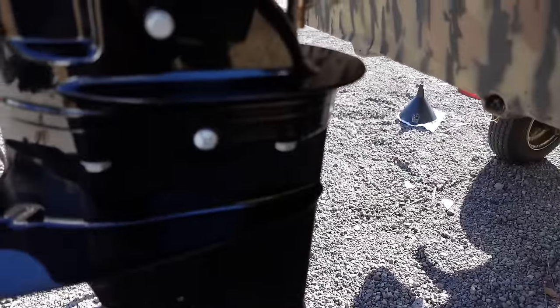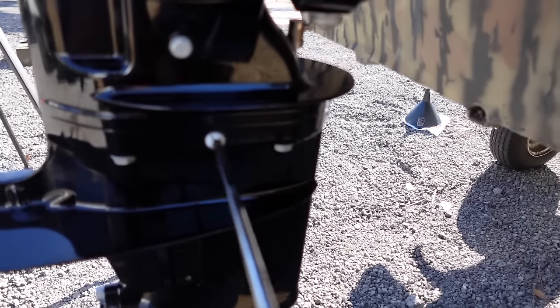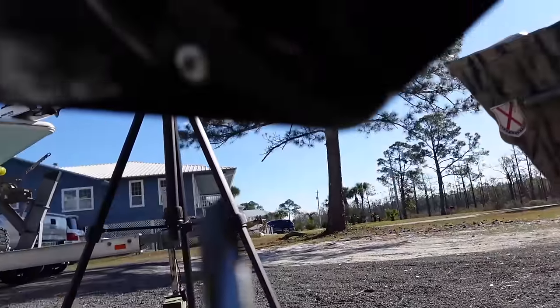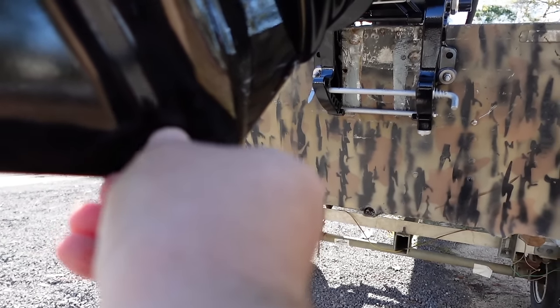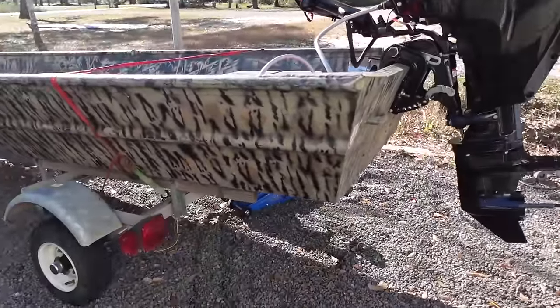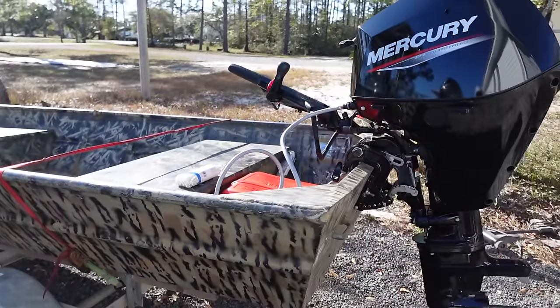I need to see if there's oil in here. I assume there is, but you never want to assume things when it comes to stuff like this. I got a big flat head for this bottom one. I just want to see a drop. That's all I need to see. If there's not a drop, I got to go and grab some lower unit gear oil. Okay, cool. There's oil in there. Pretty much all I have left on this John boat is to install the hub kit and prop, get some gas in it,